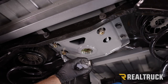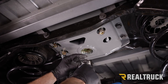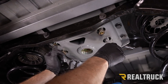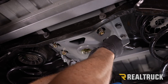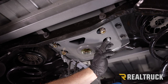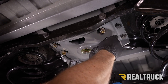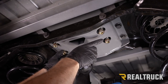We're back underneath the truck. Here are the safety chain U-bolts — what we're going to do is install a spring and nut on each one. Feed the spring with the fat side up into the hole over that U-bolt, then thread the locking nut on the bottom. Drive these up until they're flush on the bottom of the U-bolt.